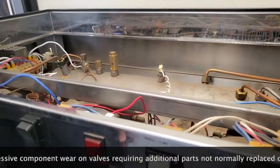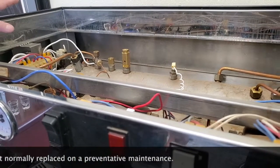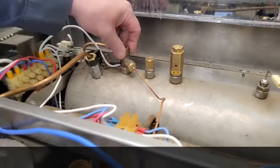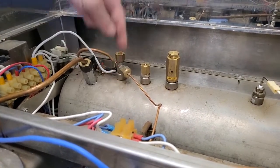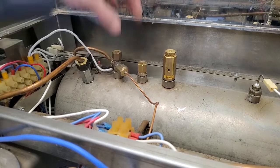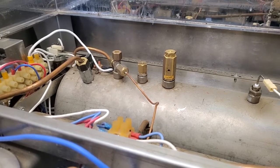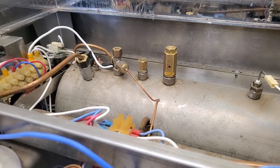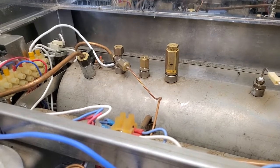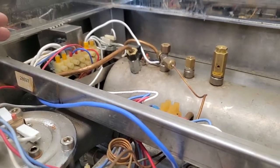The vacuum valve we covered — rebuild yearly. The safety valve: the manufacturer recommends replacing yearly, but I've never seen one go bad in a year — usually I go two to three years before I change one out. Always make sure to uncap the T fitting for the pressure switch and make sure it is clear, because it will tend to have a little bit of build-up at the end of the T right at the boiler connection. That build-up creates a situation where the machine isn't reading pressure correctly, delaying the off and the on signals.